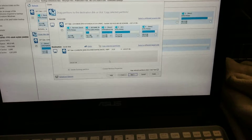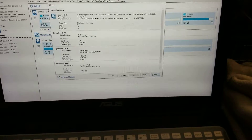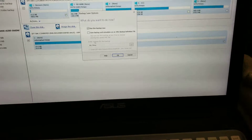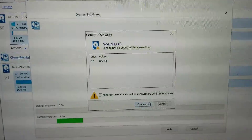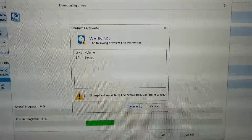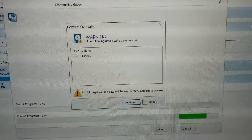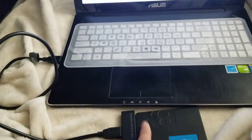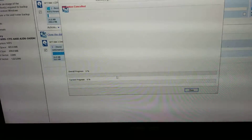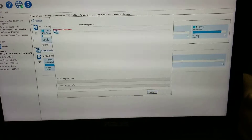Make sure that when you click Clone Disk it's on the correct disk. This is my internal drive and this is the new drive I would be cloning to — make sure you're clicking Clone on the right one. If you click Clone Disk here, it'll pop up and ask you what hard drive you want to clone to. I'll select that one. Normally it'll show up as gray like this if your drive is blank. Since this drive had data, I had to delete the partition, so now it's blank. It doesn't actually delete it until you start the process. If you click Next, Next, and then Finish, it'll ask you to start the clone. I don't save the backup schedule — I just run the backup now. Once that's done it'll pop up a message that says it's complete.